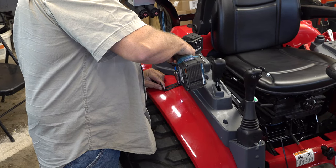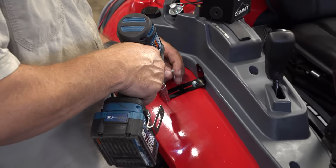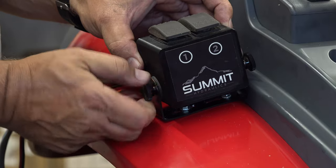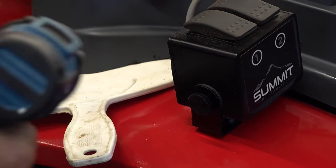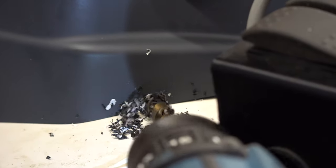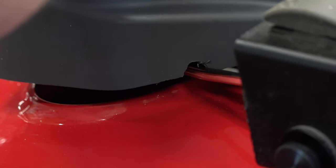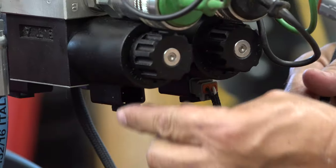It was a pain for me to drill a hole in my new tractor, but I wanted my valve controls mounted right here on the right side — there weren't a lot of options. As you can see, the right side of this tractor is already pretty busy. After I got my bracket mounted, I mounted my new electric switch. This switch just toggles backwards and forwards. All you really need to make this work is a power source and a ground. I slid a putty knife up under the cover and drilled a nice little way to route the wire through without damaging anything. I wanted a professional look when it's over. I took the three screws out of the cover so I could lift it up easily, routed the wires under the cover, and then put the three screws back in. Here's the end result and I think it looks pretty clean. Plug in the wiring harness into the valves and then zip tie everything down nice and tight.